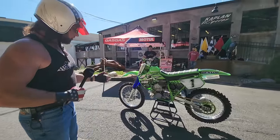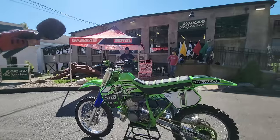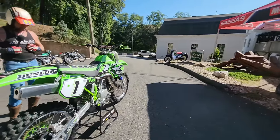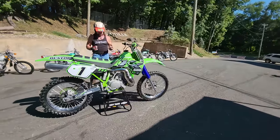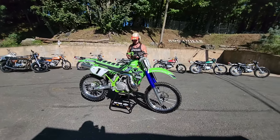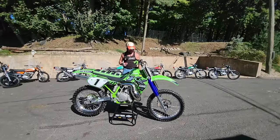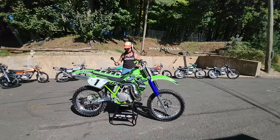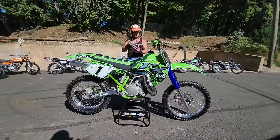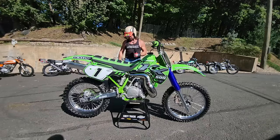The KX500 is considered by many of the faithful to be the best 500 engine ever made. I personally like the simplicity of the Honda and the durability and the violent hit of a non-power valve 500. But if you're riding it on slippery terrain or desert racing, the KIPS exhaust valve really makes it a little more manageable. Even on tarmac coming up the driveway, you can just torque it right up — the exhaust ports are closed a little more and they open up when you get up in RPM, then you have this violent hit up top which is like no other.